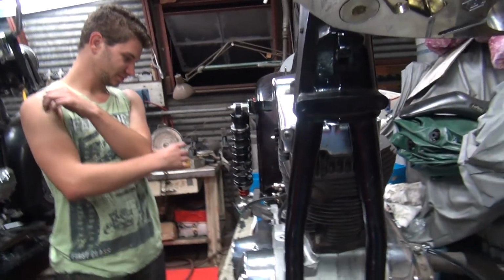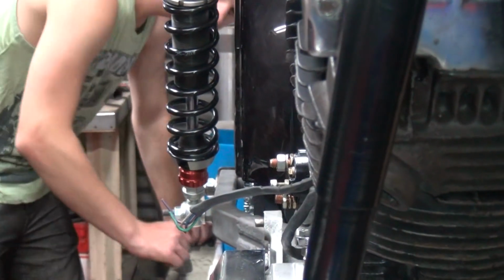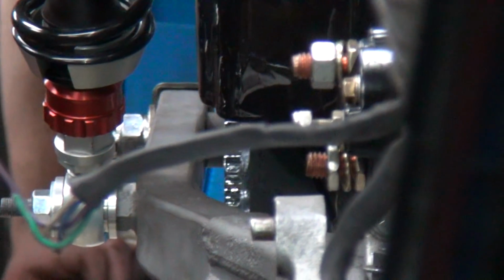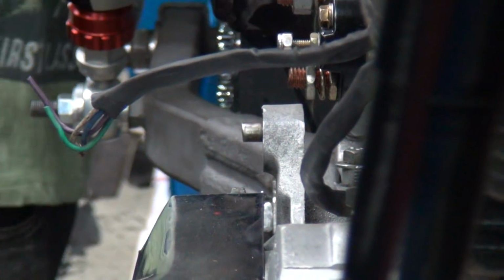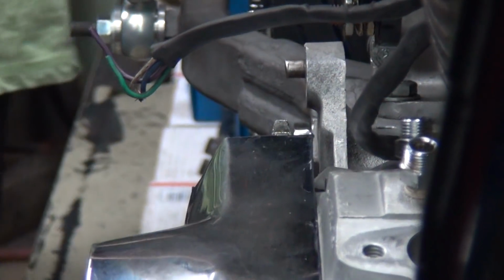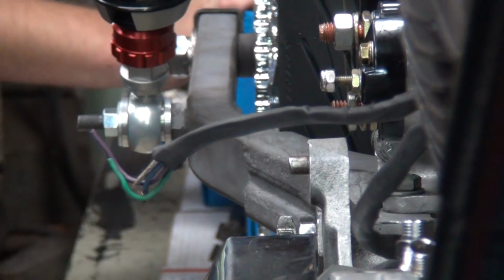But just by roughly looking down the chain line right here. So right on top of the cover, there's the chain, the sprocket right there. Oh, from here it doesn't actually look that bad. Oh no, I'm gonna take the finger off. That's not how you check a chain. Where's the sprocket? There's the sprocket right there. It's in view right there. And see how the other one's way over there? It's a full sprocket width. Yeah, that sprocket's going right through the tire right now.